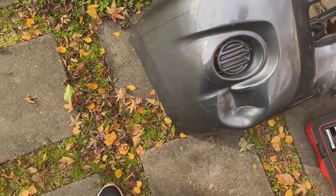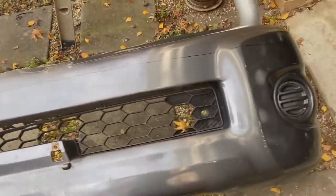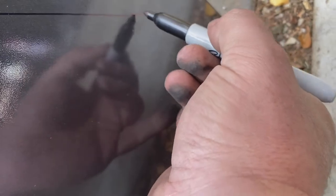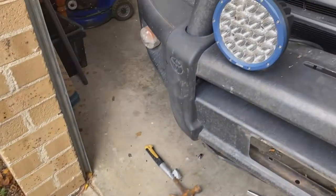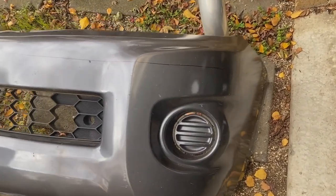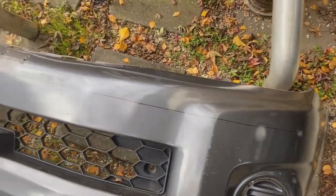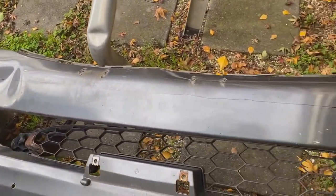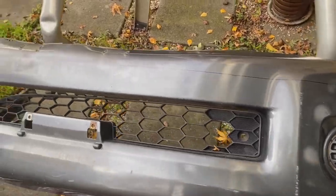This is what I've come up with — not the cleanest thing on earth, but we're going to do it anyway. I've marked out a line across this top bumper with a few measurements. That one actually needs to be cut a bit further down to the end. I'm finding that the bumper measurements are slightly out because of the accident — not by much, maybe under half a centimetre. This is just a temporary fix for now. We can actually buy one of these plates to go in this little gap, but I just wanted to see if I could do it because this bumper's toast anyway. I'm going to get my hacksaw out and cut this — I wish I had a jigsaw, it'd be a lot easier, but I'll use the tools we have. If it doesn't work, at least we tried.